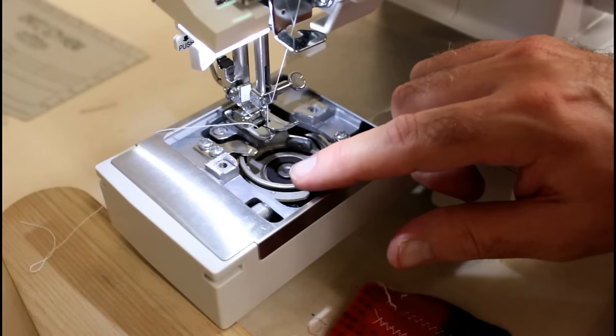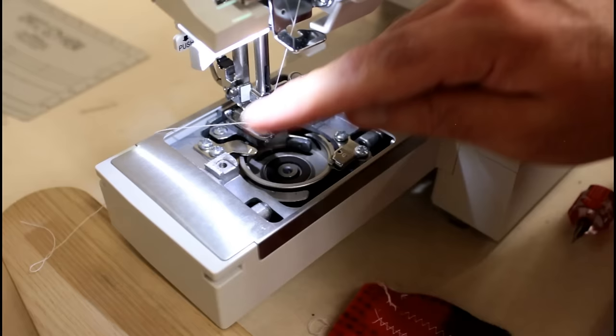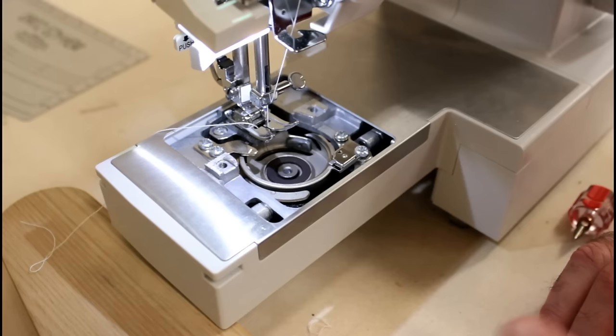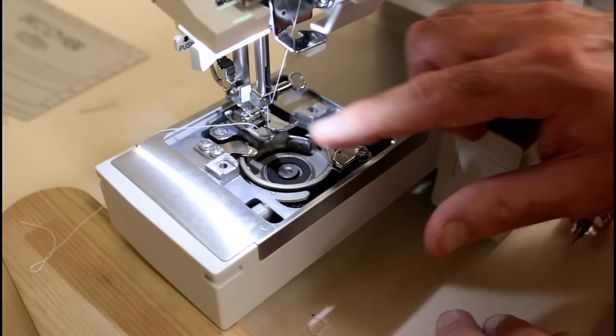Yep. All right. So what I'm going to do is loosen this again and slowly move that back over again. It's got to go back this way just about, oh God, a 16th of an inch. And it's kind of a thing you got to go back and forth, because if you over loosen this, which I had to do, it can move a little bit when you're tightening up. I had this a little bit too loose, so this time I'm not going to have it as loose as I did the last time, and I'm going to move that over. So I'm not going to show doing it because I'm just going to loosen it and move it just a hair and then tighten it back up.